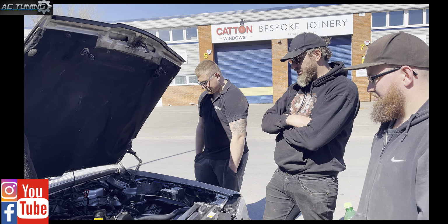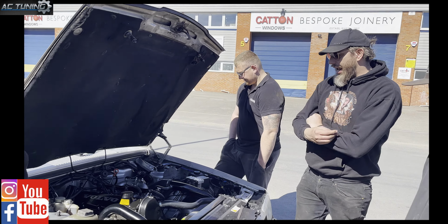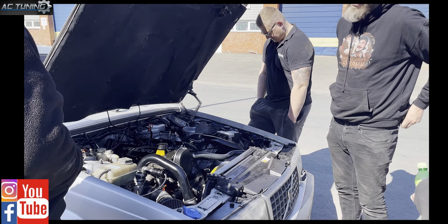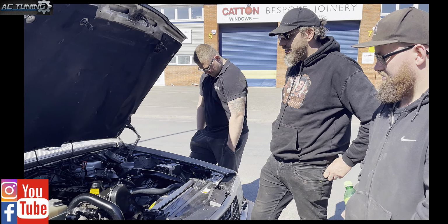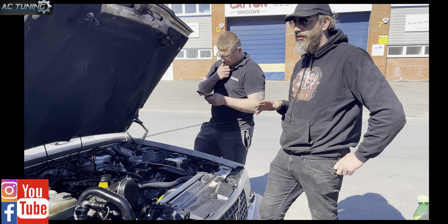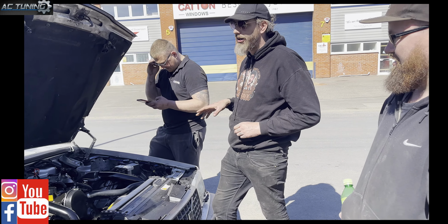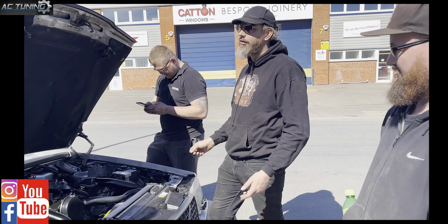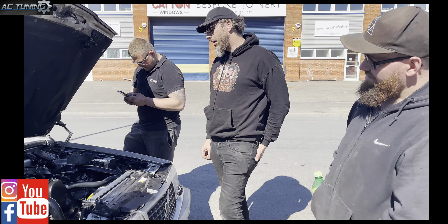Nice. But this used to be that you'd get the non-turbo cams and use them in the turbo engines, and that used to be the easy way to change the cam. But the stock cam profile is really flat. It's very diesely, about 4,000 RPM, it just runs out of power. There's nothing above it. It's obviously for pulling caravans and doing work, like the car's designed to do.